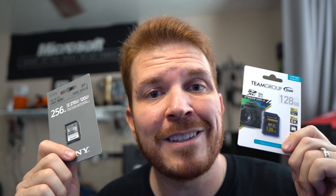After stepping up to a Panasonic GH5 and finding out that my standard SanDisk Ultra micro SD cards with adapters aren't fast enough to record at 400 megabits per second, I decided to grab some new cards. They need to be at least V60 or faster and UHS-II compliant. It turns out when looking on Amazon, there are a lot of cards that claim they are UHS-II but actually are not.